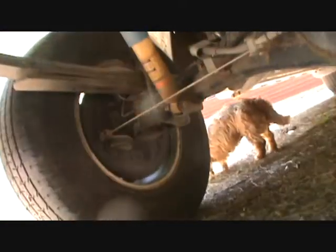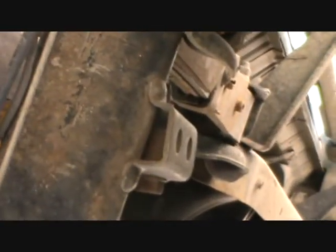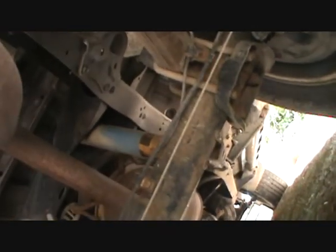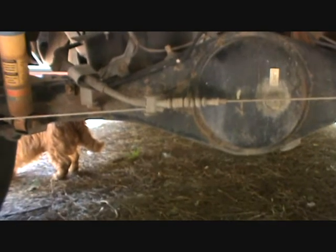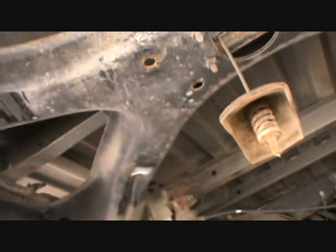On the driver's side, the easiest way to get access to the shock absorber is to just take down the spare tire — spare tire's gone and you have easy access to the lower nut, and you can also get right to the upper nut no problem. On the passenger side, because the shocks are on opposite corners, I'm gonna have to pull off the wheel to get to that shock absorber and possibly unclip a wire at the top. I've jacked up the truck and I'll try to pop it out.